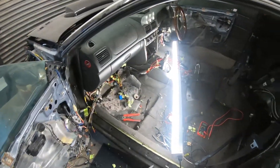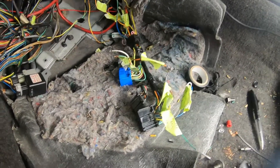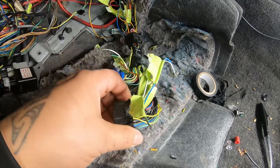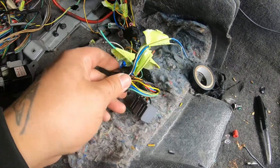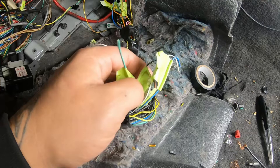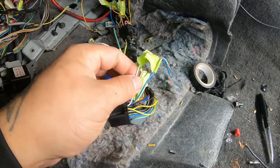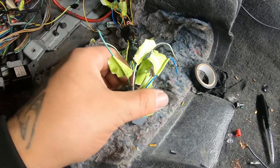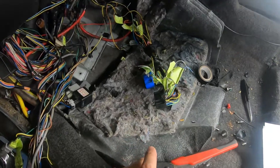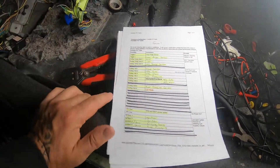Alrighty, so a few hours have gone by. I've changed some wires and I've cut some wires. I wasn't able to de-pin it, which would have been the ultimate option — de-pin, swap holes and so on. So I've had to cut and solder, and I'll probably have to do that for the rest of them. If something goes wrong I'll sort it out later. For now I've got all my wires ready on each plug. So now this loom, including those wires, matches my input/output table.